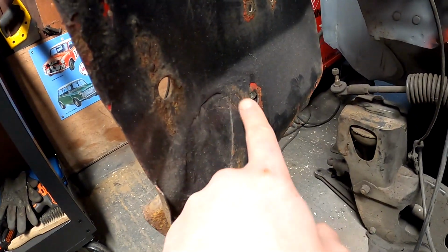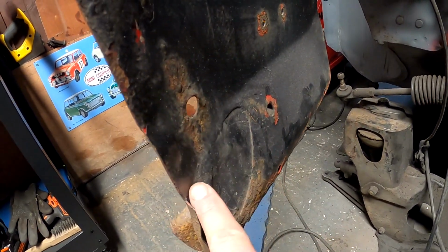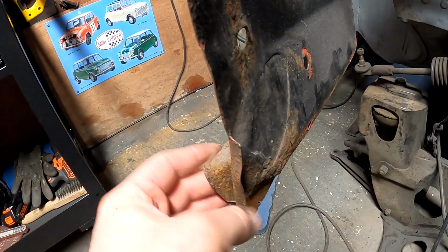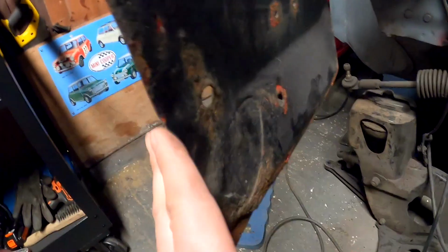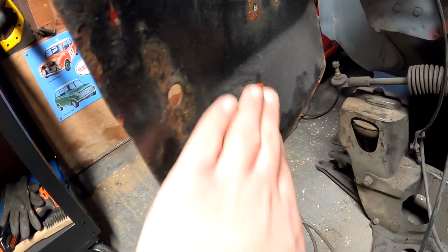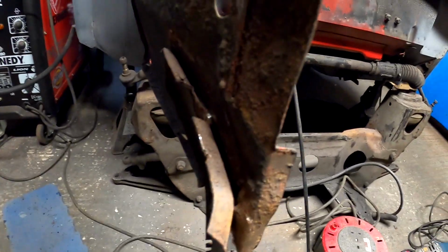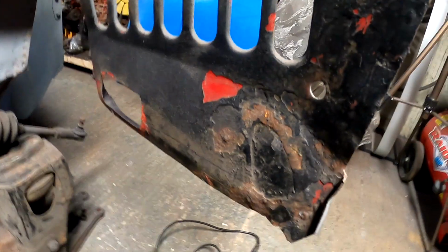It's just basic flat steel, and obviously you manipulate the shape of it as you're welding it in, with a folded tab on the front there. And it just meets with the front panel. So as long as it comes out no further than there and I can fold that tab back round, I did it okay on that car. So what we're going to do is crack on and get that done, get them cut off, find some steel, and we'll get welding in.